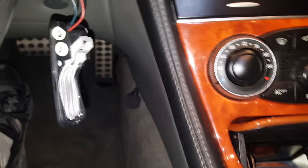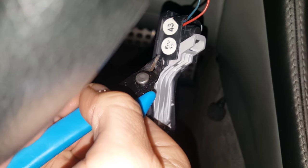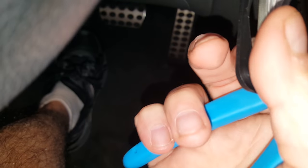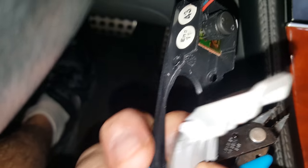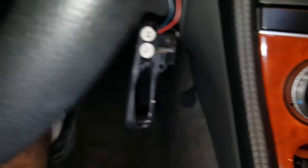Since I don't care about the existing paddles, I took a set of wire clippers, stuck them inside between the paddle and the housing, and chewed the button up until the notch on one side fell through. That side is now free, and the paddle pops right out — super easy. Now I'm going to attempt to put the G-paddles in.